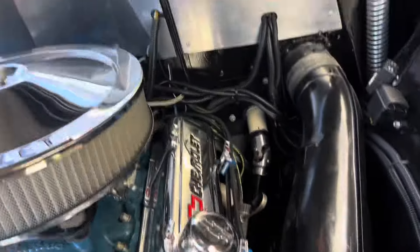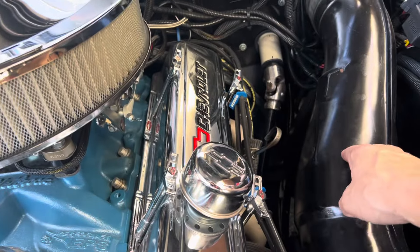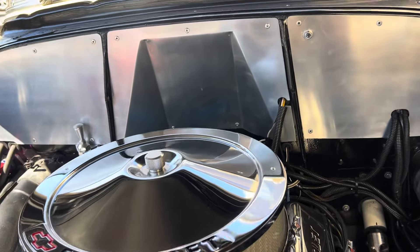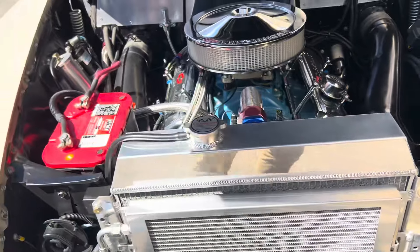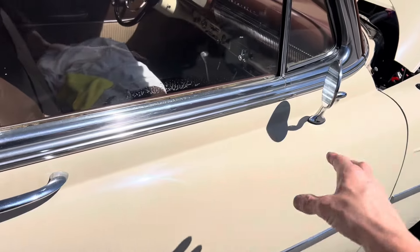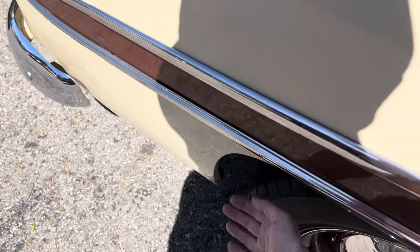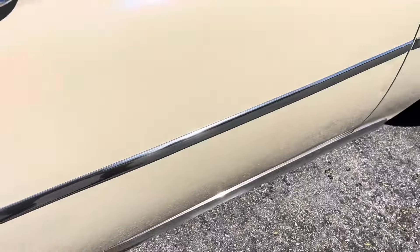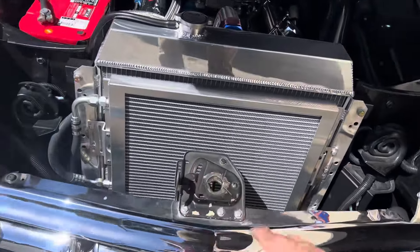Another Prius evaporator somewhere down in here — two fans in the front, never taking any space out of the Gullwing's leg area. Deliver two evaporators from one single electric compressor and never modify any of the underdash space or take away the leg room. That is missing in a lot of old European vehicles because, unlike American cars that have a lot of leg room, they don't. So that was my modification for doing European cars without touching the dash, and just hooking the electric compressor in the back, in the glove box area, or some of the European cars that are flared out and really big down here — below the floor some of them have a lot of area for electric compressors.